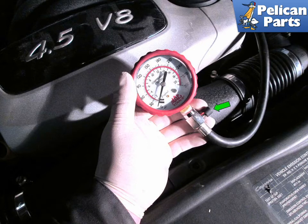Please follow the link provided at the end of this video for additional assistance with those tasks. Install the compression gauge in one spark plug hole and crank the motor over 12 to 16 times while holding the gas pedal all the way down. Once the gauge stops moving, record the results of that cylinder. Now relieve the pressure in the gauge by pressing the release valve, green arrow, and repeat the whole procedure for each cylinder.